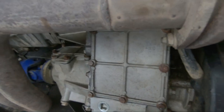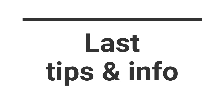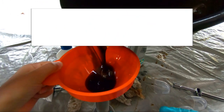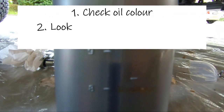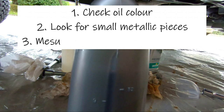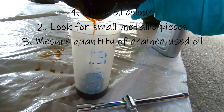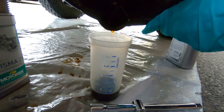There, it's done! And of course, don't forget to ditch your used oil the correct way. Just to have an indication of your transfer box health, have a look at the quality of the oil you drained. The color should be quite similar to the new oil, just a bit darker but not black and burnt. Also check if you find some small metal parts — it's not supposed to happen but you never know. Maybe you can prevent a future breakdown only by checking this. Another thing you can do is measure the quantity of oil you drained. If your transfer box is well sealed and has no leaks, you should have 2.3 litres of old used oil drained. Our transfer box has a few leaks and we drained 2.2 litres, but all is okay — we only lost 100 millilitres since the last oil change.